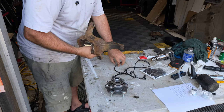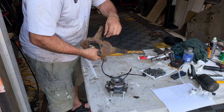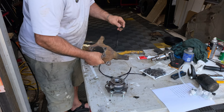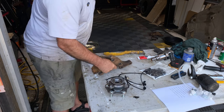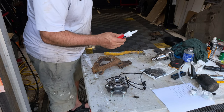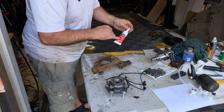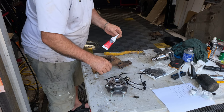This car is only six years old, but being plastic in metal the rust grabbed it so hard that I could not remove the sensor — I had to drill out the old one, that's how seized it was. So I'll throw a little bit of anti-seize on the new one so it doesn't happen again. You can also use Molly coat M77 — this is the Honda-branded product, but it's basically Molly coat M77 and can be used in place of anti-seize.